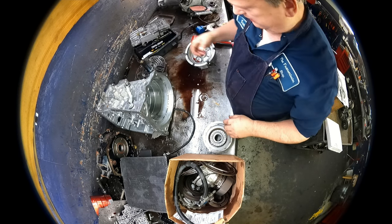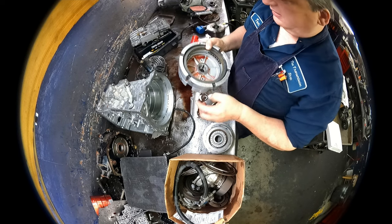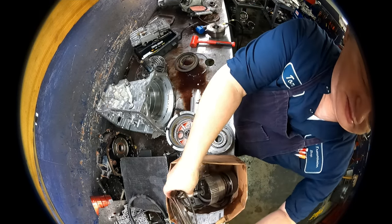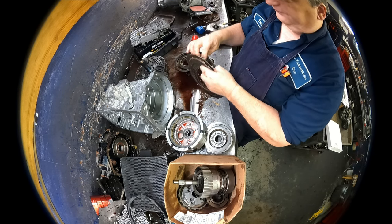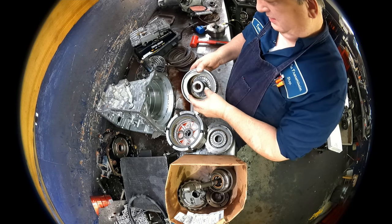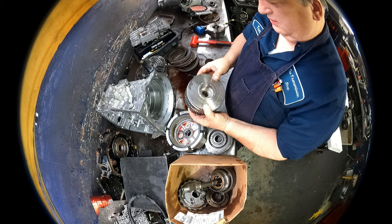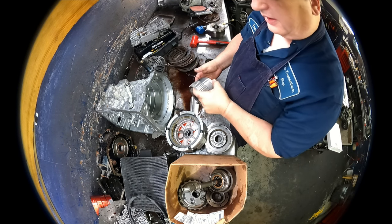Pretty decent looking bushings all around there. Let's see, we're going to take this port apart. There's a race on each side. Make sure we're not ring grooved. Looks to be okay. Neutral switch. Looks like the old clutches were pretty burnt. Let's see what we got going on here. Hopefully he hadn't touched the valve body. That's my main concern. Bushings all look really, really nice. A tad bit of wear right there, but I think it'll be fine.